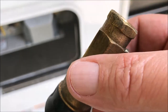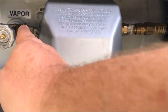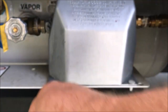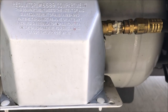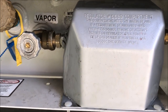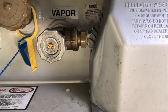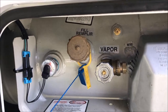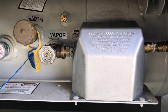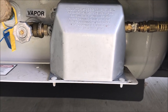So we took this off completely and just ran the connections directly through, then put some putty and Teflon on there and tightened everything down real good. There is no more leak coming from the propane tank. Needless to say, for a brand new RV that had a PDI completed — check your propane. Have them do the soapy water test in front of you so you can see there's no leaks. This is craziness.